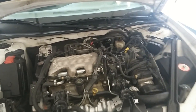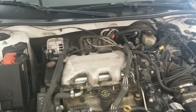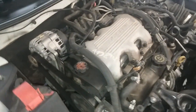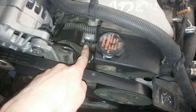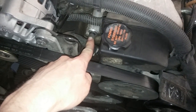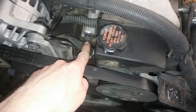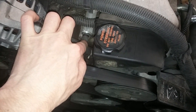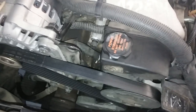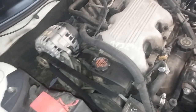So how I troubleshoot my fuel pump is first, you need to get yourself a fuel pressure gauge. I'll put a link to where you can buy one that will work, or you can typically rent them from your parts store. This is a Schrader valve on your fuel rail, the high side of the fuel system, so you can plug right in there. This cap screws off, and much like a bicycle tire or a car tire, you screw this gauge on there.